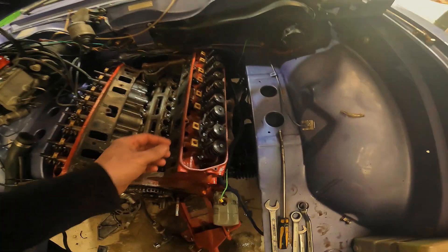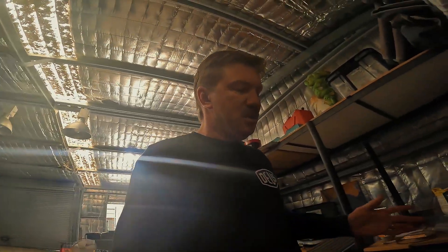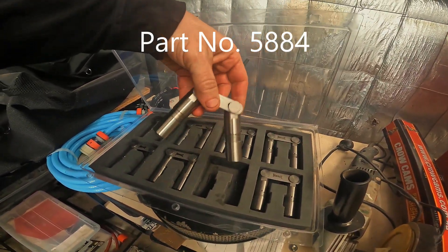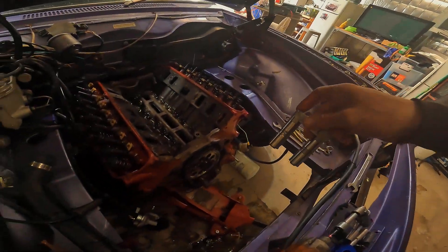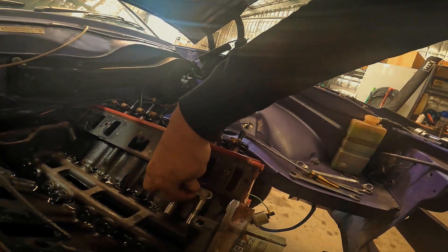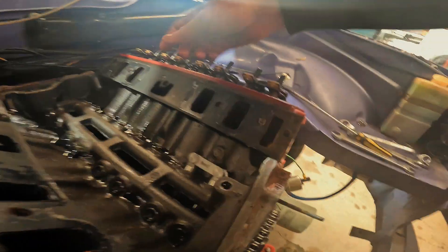Rather than spend another thousand dollars, I've spent about $2,100 to convert to hydraulic roller. I'm about to start pulling the old cam out now, leaving the heads on and leaving the engine in. Now, what I'm using to convert this - I'll show the part numbers and links in the description - this is a Morel lifter from a Pontiac V8, which has the same spacing and bore as the Holden V8. I've measured and there's still about three millimeters of cover on the lifter bores for that oil hole.